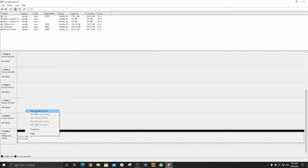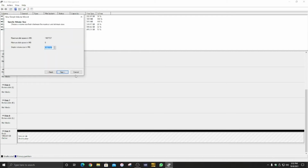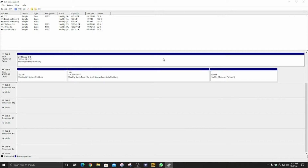It says on the label that you can format it in the box, but we're not going to assign a drive letter, and we're going to throw FAT format on it for right now. It may or may not work. Once we put it in the box, we might have to pull it out and delete the partition. I don't believe so, though. Some NVRs are so cheap they just cannot. Okay, looks good. Let's power it down so we can unplug.